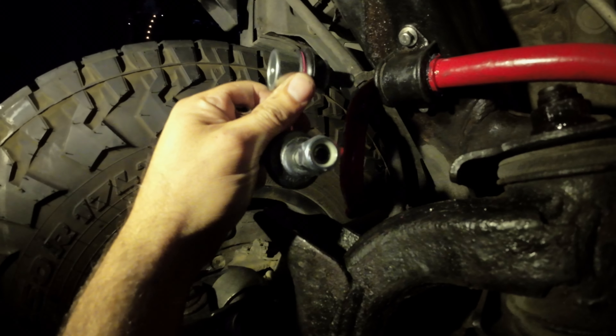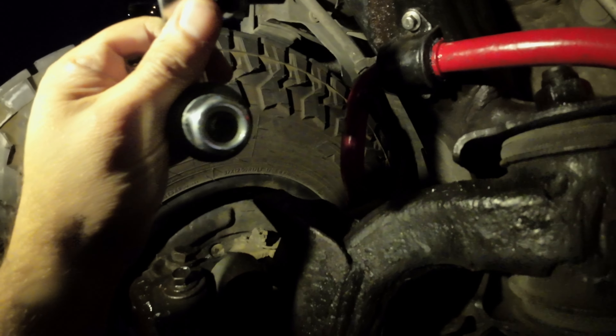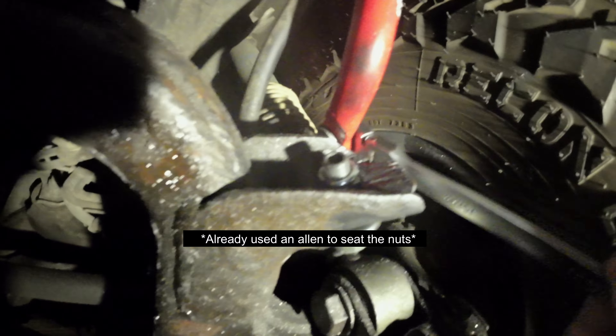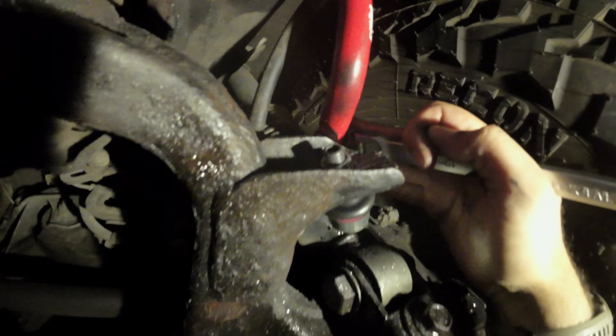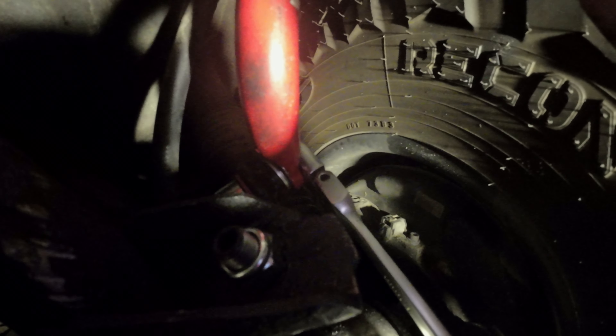Let's throw this bad boy on the car and tidy up. It'll be a 19mm nut and a 7mm Allen on the inside, and hopefully this doesn't strip because it's all brand new metal. We got her on — on the driver's side — and now it's just a matter of cranking on the 19mm self-locking nuts on the outside. You can get different end links; they even make extended ones for some first gens, so I'm sure someone will make extended ones for second gens soon. Almost buttoning up this side — let me throw on the Allen key on the inside so I can really crank this down, and then we'll do the other side and move on to throwing the drive shaft back on.